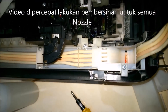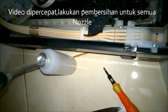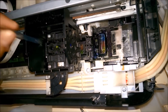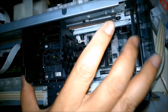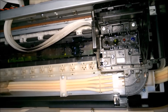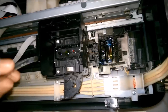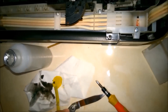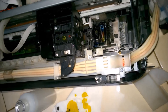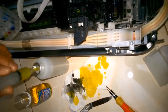You can see I am using a syringe and a tube to clear the nozzle head. You have to just take some water and a tube, put it in the nozzle, and push that water through. You can see it automatically clears the inside ink of the nozzle, which will help the new ink to flow to the printing slot.